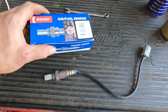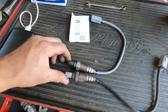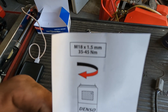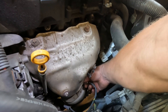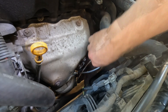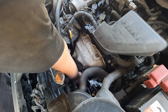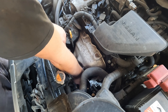We'll put our new one in and see what happens. With our new one alongside the old one, there's a slight difference — must be an upgrade to the end of it. I've double-checked the plug to make sure that's the same. It does give you a torque spec: 35 to 45 Newton meters. If you can get a torque wrench in there, do it up to that. With a little bit of finesse you can get it started — screw it in by hand as far as you can, just be aware of that wiring harness. You've only got a little bit of movement and then you've got to readjust the socket. That feels like it's clicked — 45 Newton meters, we'll double check it anyway.